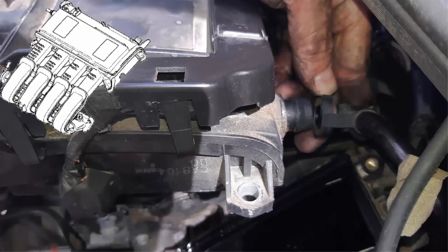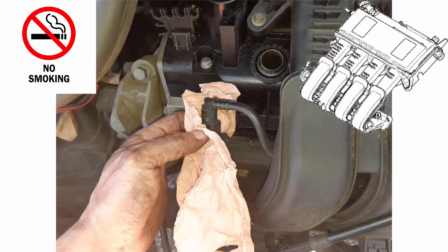Let's do the same thing for the power brake — just press the ring and then pull out the vacuum line. Same principle for the fuel line here in yellow. Pay attention because the fuel rail is under pressure. Press the blue tabs and pull up the fuel lines. Pay attention because the rag will be soaked with fuel.